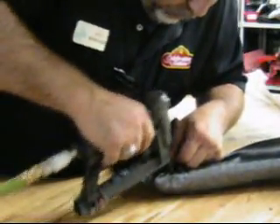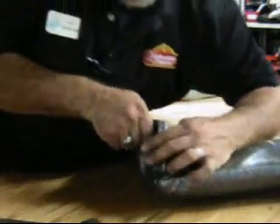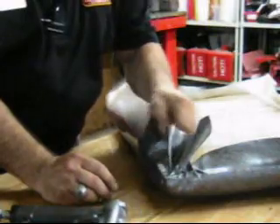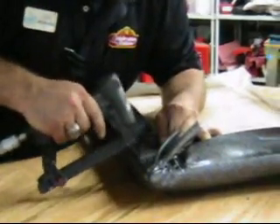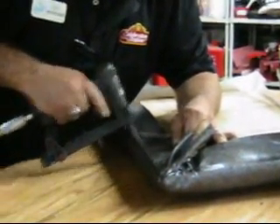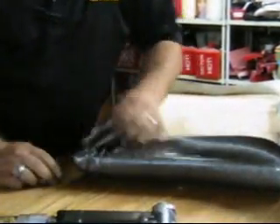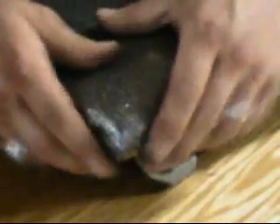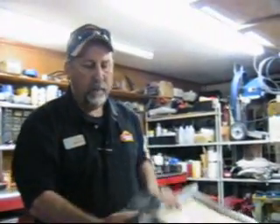You just keep working it all around, get a staple here and a staple there. Once you actually make it around the corner, put a couple of staples in — see how this material is bunched up here. You want to kind of pull it tight there so it'll stay down. Be sure to get all your little groups there and cover that. Now that corner right there turned out pretty good. Whenever you're complete with this project, it's going to look like a seat covered probably better than the factory.